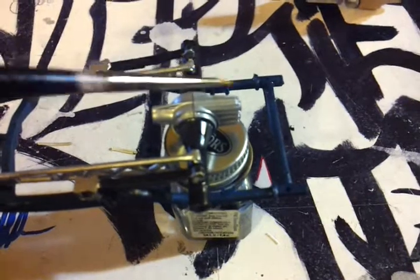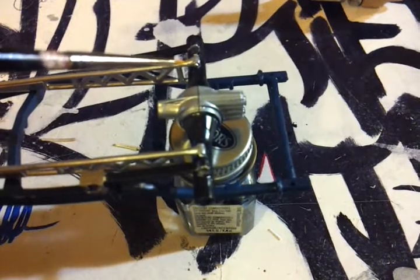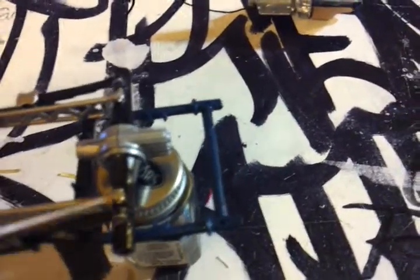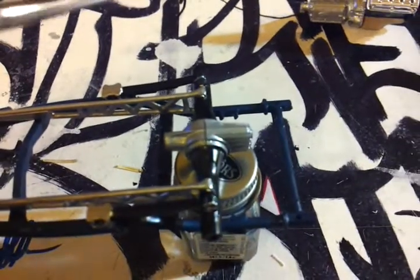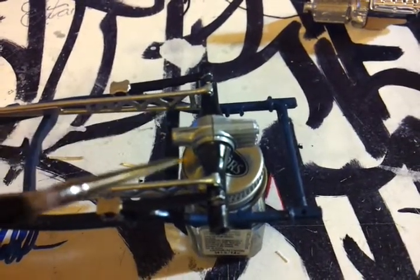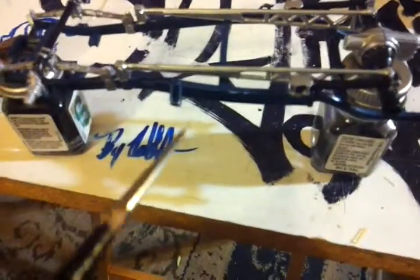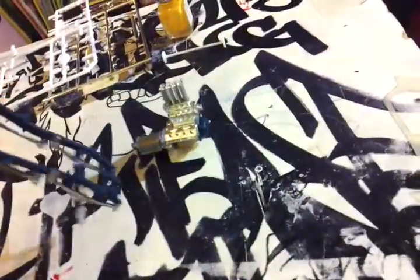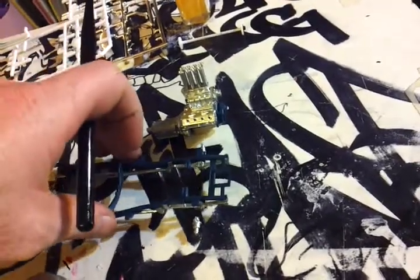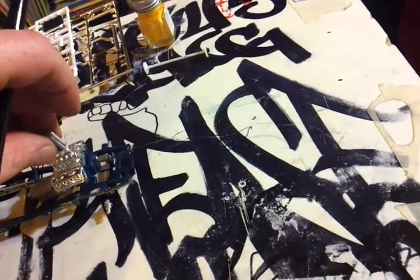But it was too long. It was setting the rear end too far back. So I cut all that out, leaving just the bolt heads, and it kept everything very, very centered. Let's see if it'll redo that. So yeah, it kept everything very centered, and it worked out very, very nice. But as you can see, I got to do some touch-up painting. I've been handling the frame a lot. So basically just detail painting that, and that'll get taken care of.